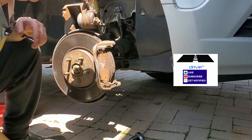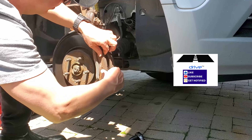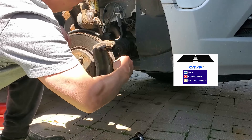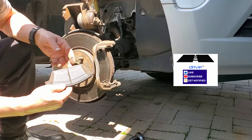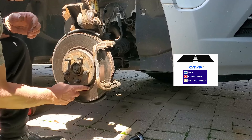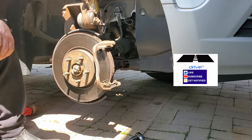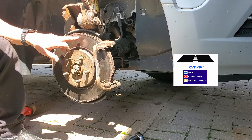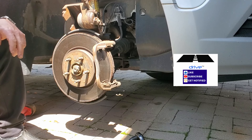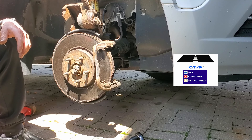Here are the two pads that need to be removed — it's just a matter of sliding them out and removing them. The one at the back can be a little more difficult. You can see how worn they are — they're ready to be changed. The rotor is still good so I'm not replacing that, though typically I'll replace the rotor as well as the pads for a good contact patch. The contact patch on both the front and back is quite good and will mate well with the new pads.